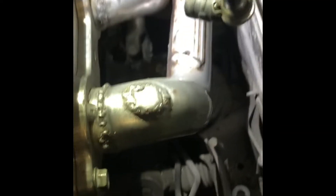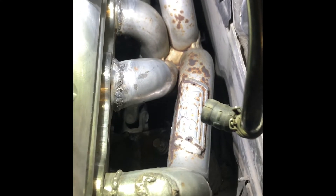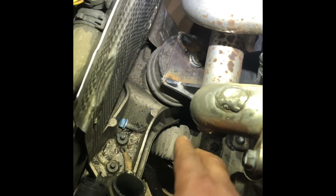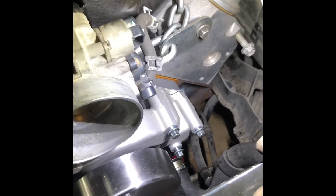I welded up the manifold as best as possible, all the way around. I covered up the little tube that I had sticking out for the EGR valve — or pollution pump, whatever it was for. This one's ready and I got the other side ready too. I cut the pollution pump plates — the EGR valve flanges — on the bottom and top, cut the flange down to give more clearance. Next I'm gonna configure the pulleys up front — the alternator and the power steering pump — and figure out how I'm gonna run the hoses.